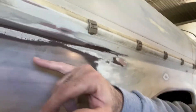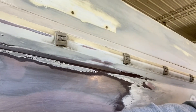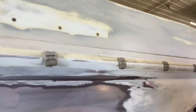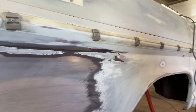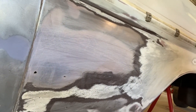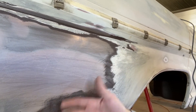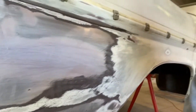You can tell kind of over here was cracked or cracking. I cut a lot of this off already but I'm going to take this all the way off and put a little bit of filler in here to raise up the low spots. This is, I think, the worst spot on the truck. Must have been a little dent there or something, and I don't know if the primer didn't react funny to it, because the paint was cracked. But we're going to get that taken care of.